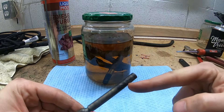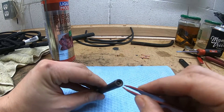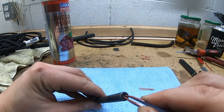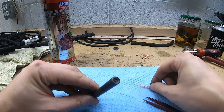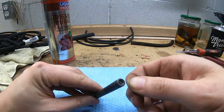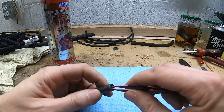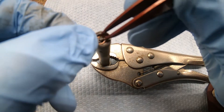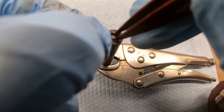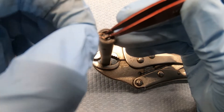There's a little screen right about here that is super super fine. This is the tip of the injector and if you grab it with some tweezers you can see I can pull on it — it's real tiny. What I'm going to try to do is use a really fine copper strand from just any kind of automotive wire and wrap that under there to keep it open. That is now pried open a little bit.